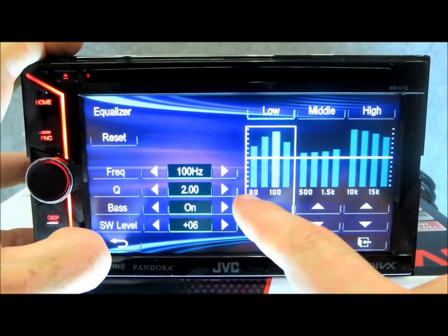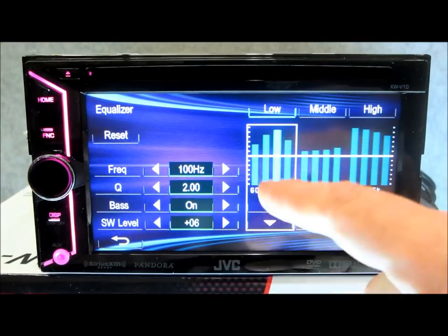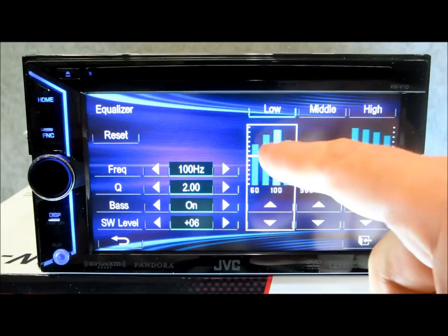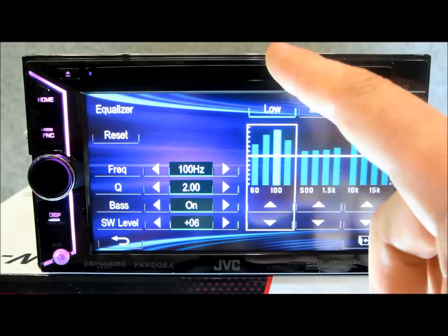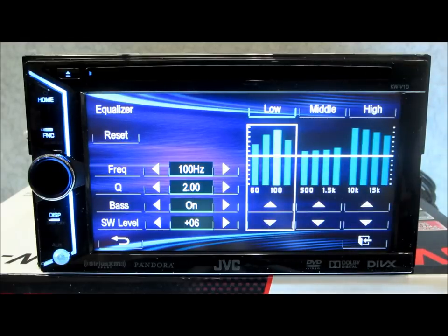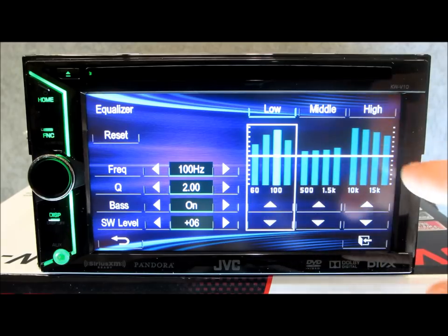Now watch this. Say I want to adjust 60 hertz. Say if I wanted to do like 60 hertz and 80 hertz, cut those down, turn them up on my subwoofer, and so I have it set at 80 hertz and lower for my subsonic, and on my front interior speakers, I want to limit that so I can have a digital bass blocker, even go to 100, and I have a bandpass filter block all the low frequencies, which are damaging and distorting to my front, rear, and center channel, if applicable, and have my rear doing all the grunt work, and I can have this thing full blast loud and enjoy all the lower mid-range high frequencies that I love.